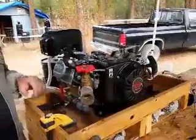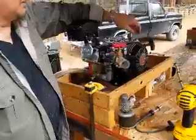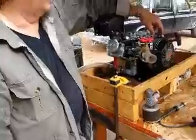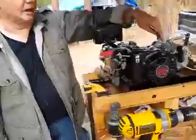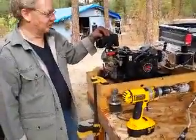One is the engine oil, which initially doesn't make sense, but there's a sensor in here that determines whether or not there's engine oil pressure. When it spins up and there's no engine oil pressure from low oil, it has a circuit on the side here that kills the spark, and that protects your engine.